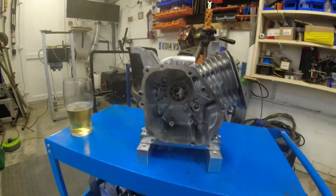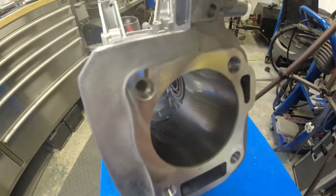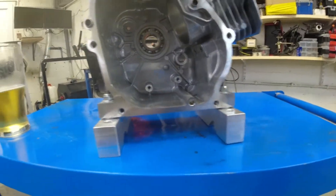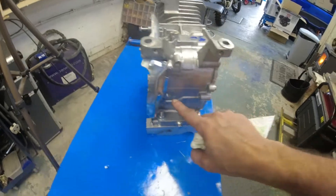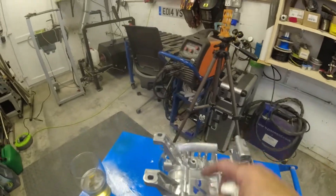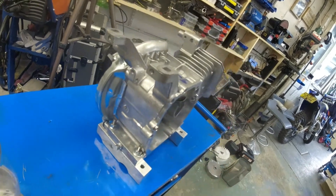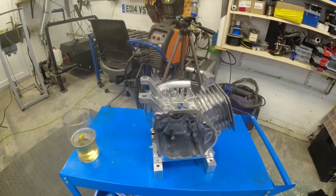Right, so it's fully stripped now. I've taken absolutely everything off it, removed the governor. You can see the bore is absolutely mint — you can still see the cross-hatching from the initial boring. There are some small holes left over from the governor. The governor, if you don't know, is a device that holds the revs to no more than about 3,600 RPM — it's a pressure washer or generator engine, not meant to be revving. With the governor removed, it should be able to rev to whatever we want. I'll put bolts and copper washers through to seal those holes up, and then we can start assembling.